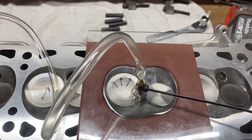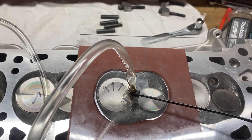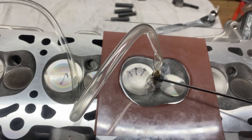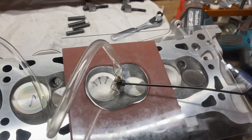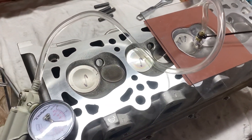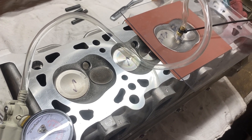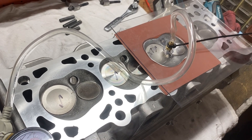On the third spark plug swap, the leak stopped, so I don't know for sure what that was all about. But I pulled the valve back out of this head, and it was one single thread from a red shop rag that was in between the valve and the seat. And that's enough to cause that kind of leakage at the valve to seat interface.